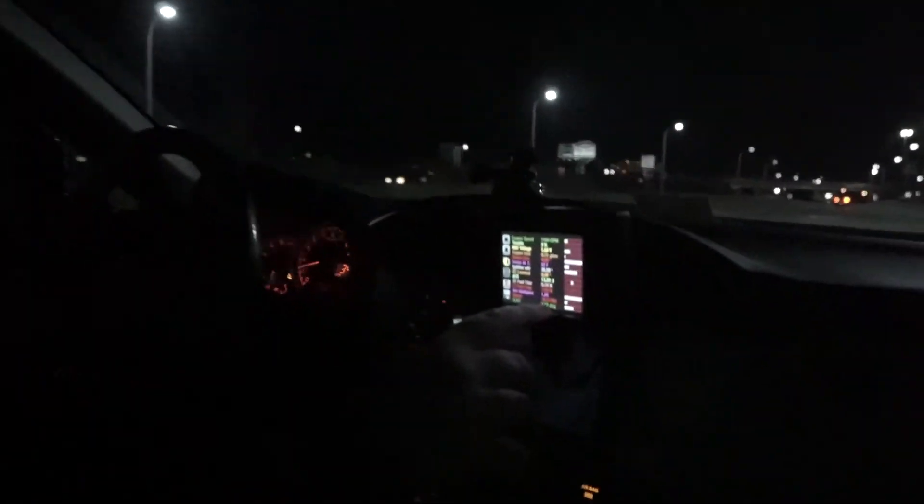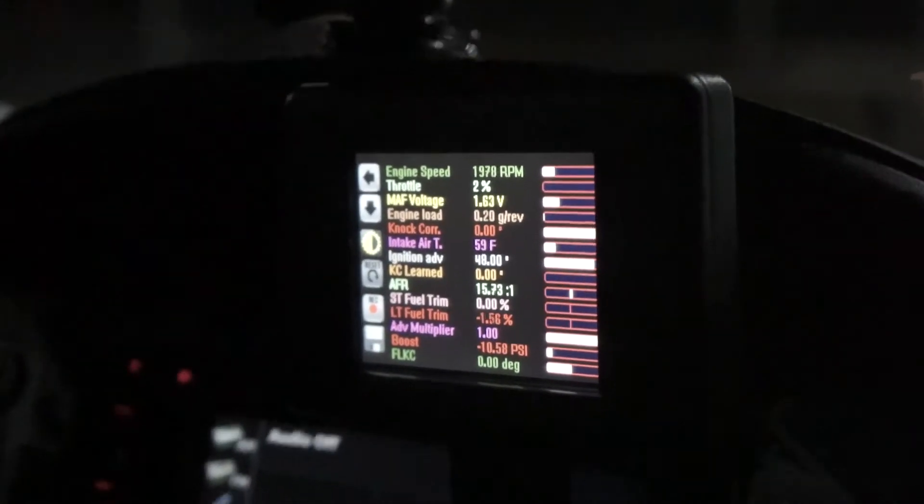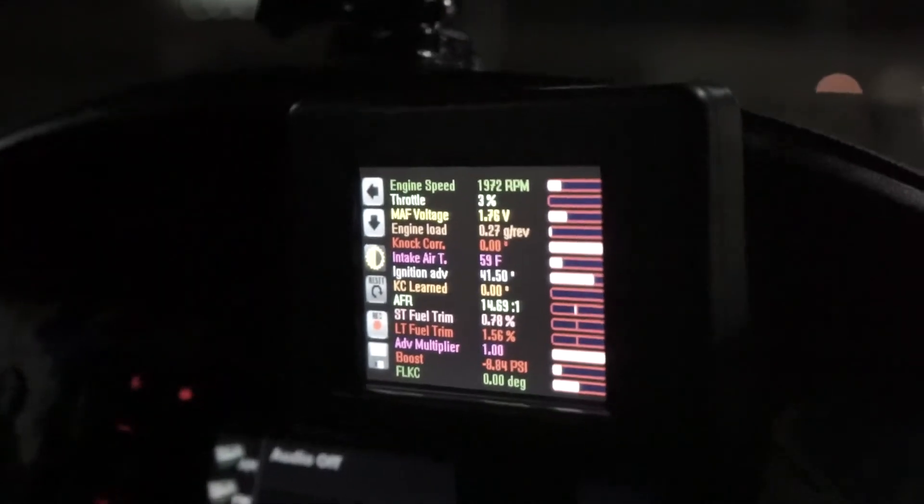The target is roughly around 4% or so for the LT fuel trim. You'll see your ST be a little higher than it was previously when you're on load, and it'll be right about where it was previously otherwise. Not a hard process at all. We'll do a 40 mph roll.